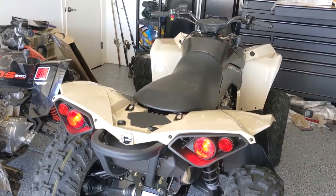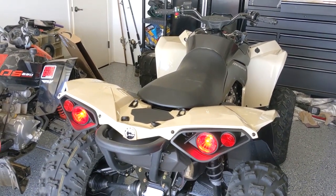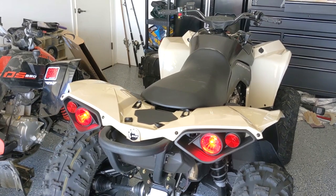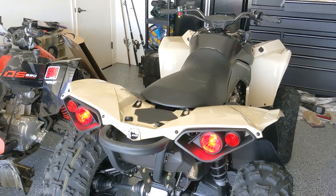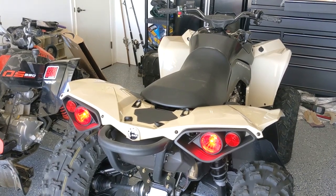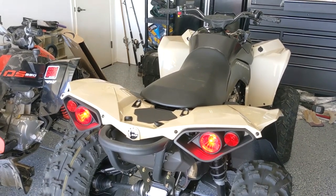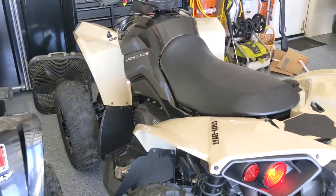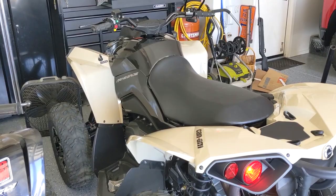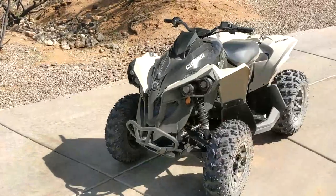See what the wife thinks about it. Our biggest complaint was how hot it was — it ran really hot, and I agree. I took it for a ride and it would burn your leg off if you weren't wearing pants. Obviously that's partly due to the placement of the exhaust, but with the tune it's supposed to run a lot cooler. When you're running too lean, you're going to run hot — anybody who knows anything about tuning, even a carbureted vehicle, knows that. Running too lean is how you burn up your motor, so we've got it richened up.